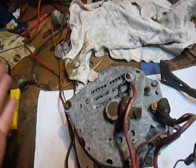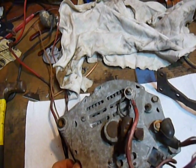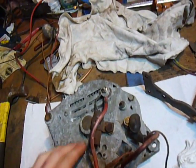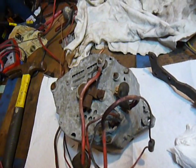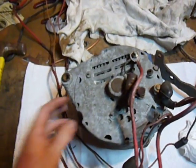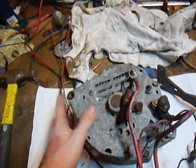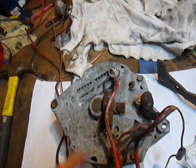The M1010 is the exception to this — it uses a 24 volt system that's completely different, they're kind of a nightmare, and I'm not going to get into that in this video. There's a great PDF on the internet put out by a company retrofitting these for brushland fire trucks or the forest service, and it tells you how to convert the 24 volt to a single alternator 12 volt system or a dual alternator system charging two separate batteries. I hope this helps somebody retrofitting one of these engines so you can better understand the charging system and not get confused by some of the misinformation out there. I'll be making another video on Dana 60s and I really appreciate the comment that spurred this video.